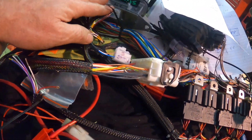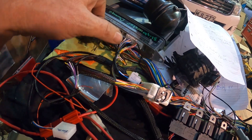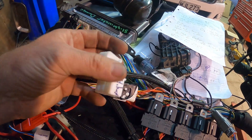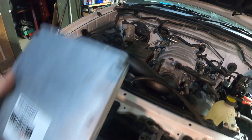I've also done a little tricky thing: the temp gauge on these Hiluxes requires the factory ECU. So in this wiring loom — these two plugs here plug into the factory ECU. The factory Hilux ECU has its own kind of multiplexed signal on the temp gauge and it goes through the factory ECU. So what you do is mount an extra temperature sensor — there's one in the box with this loom — and in the factory spot down here you drill and tap it, put the new temp sensor in, plug that in, and the temp gauge works. In this case the tacho will work as well.